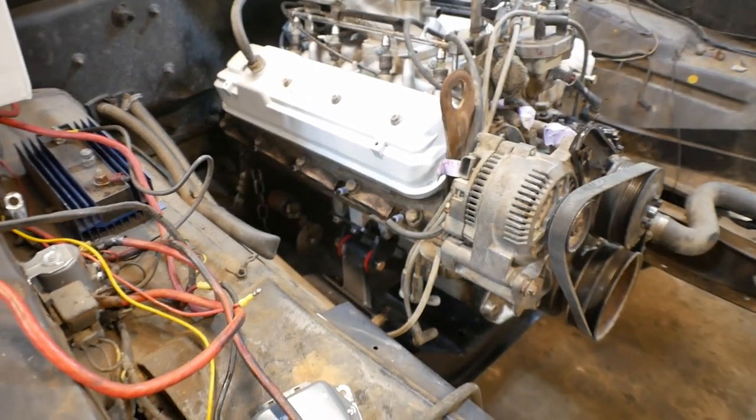I think it's also worth noting, I'm using a fuel-injected engine from a '96. This engine architecture goes way, way, way back, like way back to the '70s. So the block stuff is all pretty much the same. And I must say that the actual engine adapter side fits flawlessly. So if you're worried that this kit wouldn't work on a modern fuel-injected engine, not a problem.